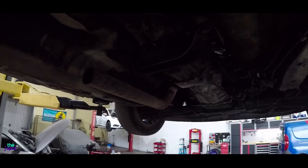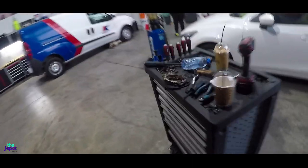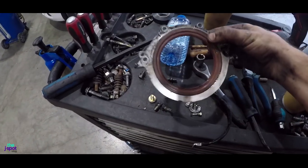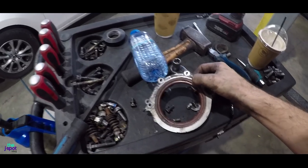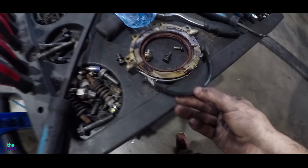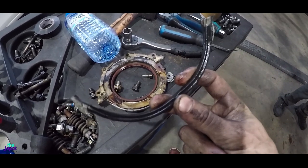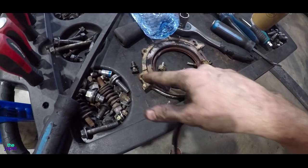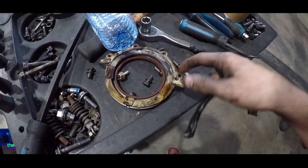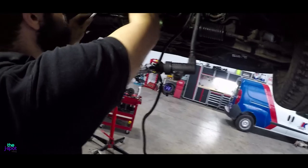What does this car decide to do? There's oil all over the garage and we don't know why, so we need to take off the gearbox again. A few moments later — over here we have the main crank seal at the rear of the car. We think maybe the crank seal didn't sit in its place properly, and we've realized it's this little rubber section that fits underneath. It basically hasn't been changed since the car left the factory in Japan. We need to see if they have this piece at the parts store — the gasket. We need one of these, and we need a lot of silicone. Now we need to clean everything up and order the parts.